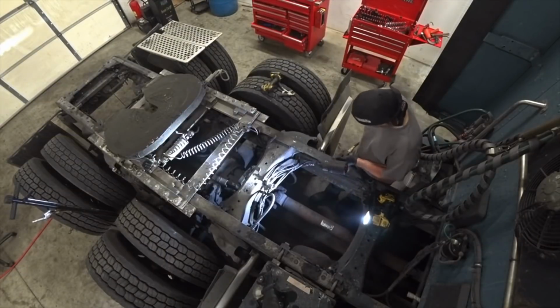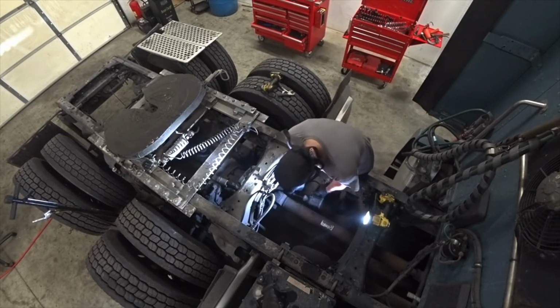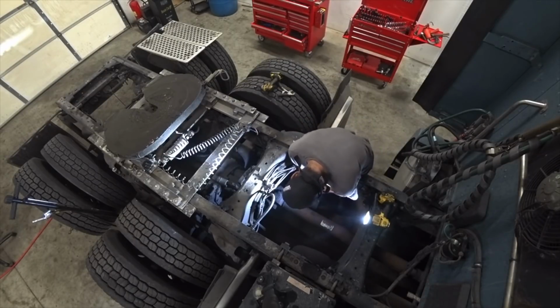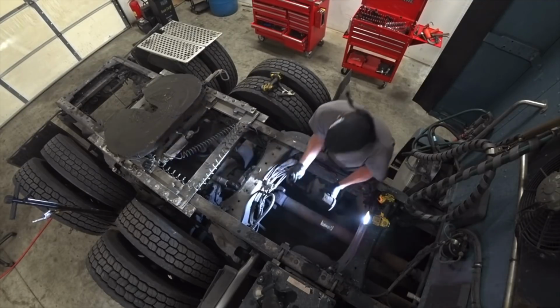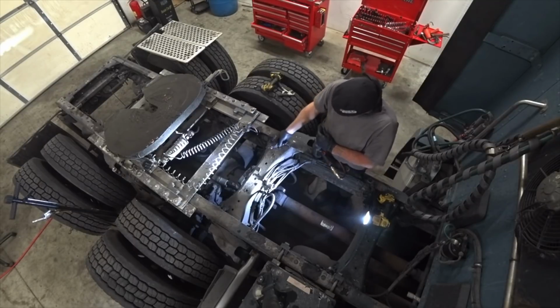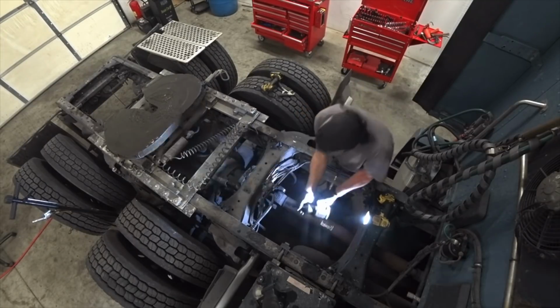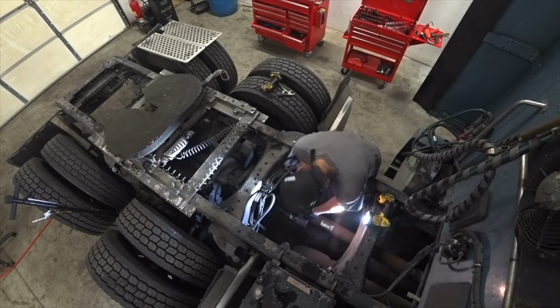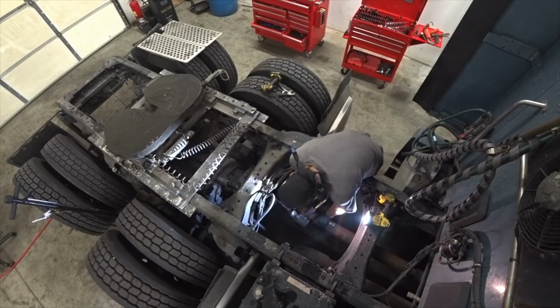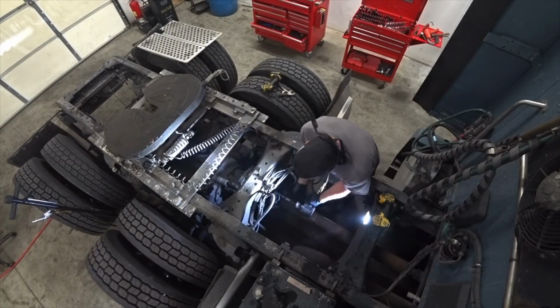So there's just basically 4 bolts here. They're 1/2 inch 12-point sockets. That pulls the cap off the U-joint. The U-joints are fine. That's the reason why I have one tire jacked up, so I'm able to spin it.